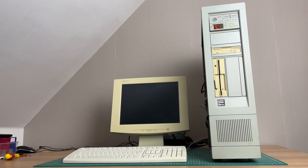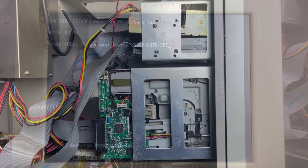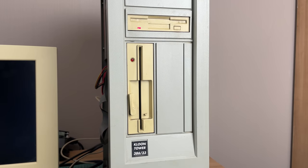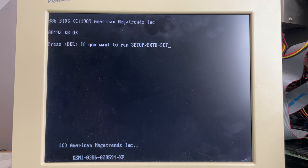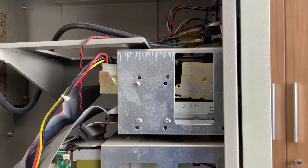I'm just going to turn it on and see if it boots. I absolutely love the power switch on this thing. After a while we see the Trident VGA boot screen, followed by the memory count with the typical PC speaker sound - this is probably going to be 8 megabytes judging by the RAM sticks. It initializes the floppy drives and then it should initialize the hard drive and continue the boot process, but it doesn't. Instead we're getting a fairly generic HDD controller failure. I'm guessing it's related to the hard drive itself, because after a few power cycles I noticed that while normally a hard drive keeps spinning, it actually shuts itself down - it probably encounters some kind of internal failure state.